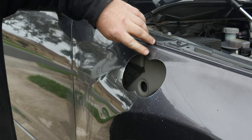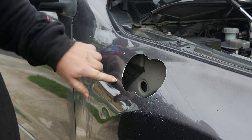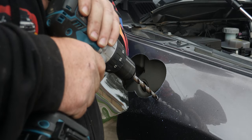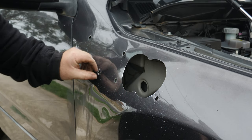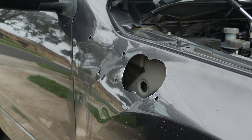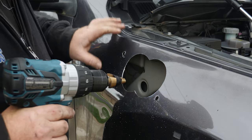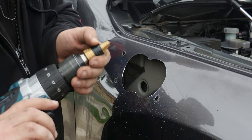Now I need to flatten out the edges and increase the size of the smaller holes to M16 using a step drill. First, increase them up to M10. Large drill bits on thin sheet metal don't work too well — that's where a step drill comes in handy. This one goes from 10mm up to 30mm and works really well on thin sheet metal. I've put a bit of black tape on it so I know where to stop.